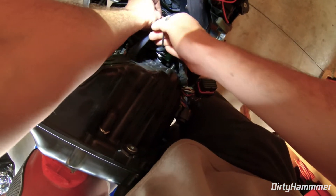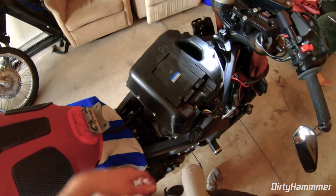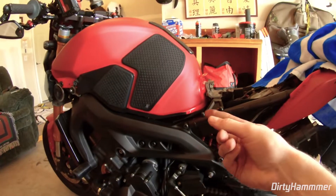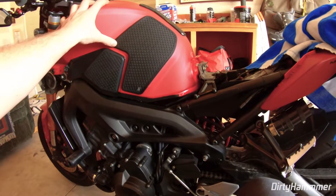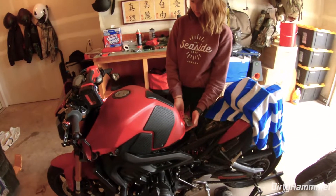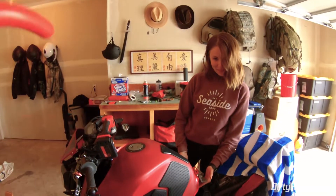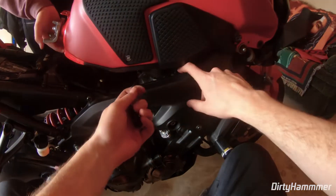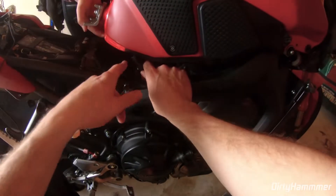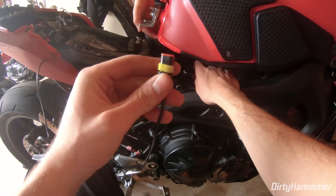Once you have all three spark plugs wired up, route that wire toward the back of the bike. Put the airbox back on by doing the removal steps in reverse. With the tank back on, airbox on, and ECU plugged in, lift the tank and reconnect the breather hoses — those are now clamped back in place. I routed the spark plug cable underneath the airbox and up so it'll connect underneath the tank, plugging directly into the cable from the quick shifter module.